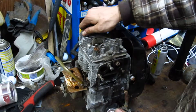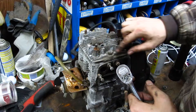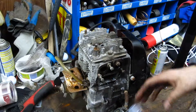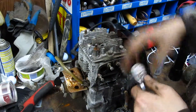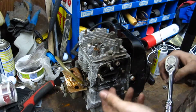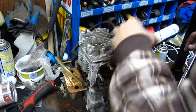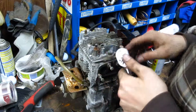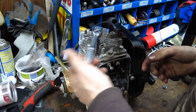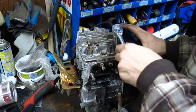So remember when you torque down the head — always torque it in a criss-cross pattern, even with a used gasket. Because if you torque it one way, it can wrinkle the gasket and break it. But if you criss-cross it, it actually tightens the gasket properly and puts everything down at proper pressure all the way around so it doesn't damage the gasket. Usually there's actually a three-step torquing method — same for car tires too — where you torque it at low, medium, and then full torque. But most people just skip to straight torque, or just a two-step with medium then hard. I don't know the torque specs for this, so I'm just going to start off with a low-medium torque, then do the stronger torque.